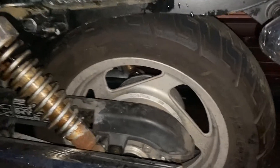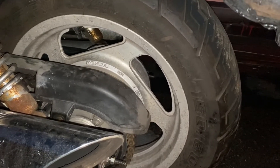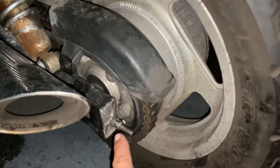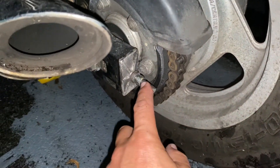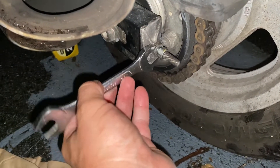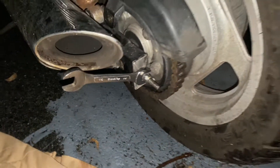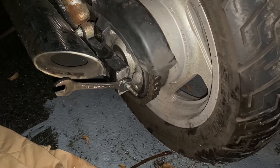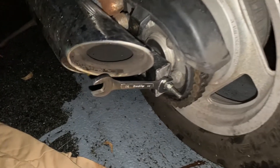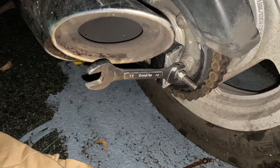If you don't see another video on adjusting the chain on this 94 Magna, then I guess we did it right. Locking the nuts down — this side is a 12mm, the other side is a 13mm for whatever reason — throwing the 14 on here just to hold that in place while we tighten it, then tighten down the axle and we should be good to go. It's pretty wet and dark out so I won't ride it tonight, but if you don't see another video on this we're probably good. Get out and ride guys — I'll see you in the next one.